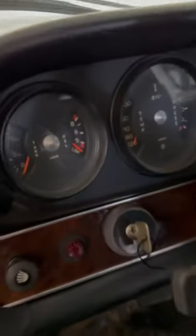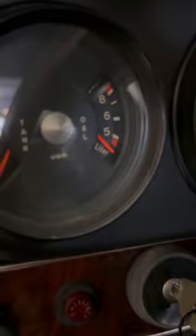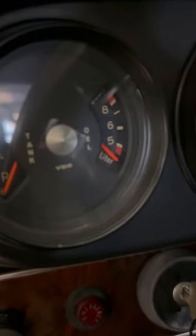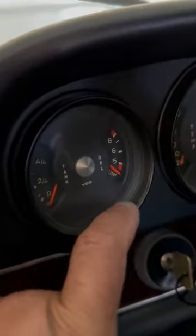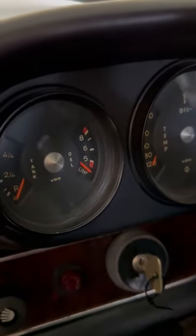You can also watch the gauge as you're putting the oil in — it'll come up to maybe five and then reach six, and this is with cold oil. You reach six and you'll be pretty good, but do not assume this is correct all the time. Go by the dipstick. If this corresponds to the dipstick, then you're good. If it doesn't, then you know how much the difference is.